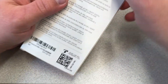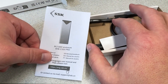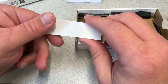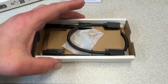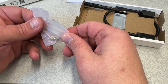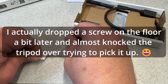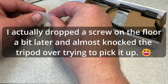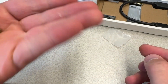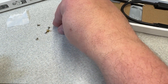So I'm going to open the NVMe enclosure. It comes with a manual — we won't need that, but if you've never done this you might. Here's a thermal pad that we're going to put on our drive in a minute. It comes with some extra screws and standoffs, which I really appreciate. We're only going to need one set. And you've got this little brass standoff that's very common in M.2 drives, even on a motherboard.